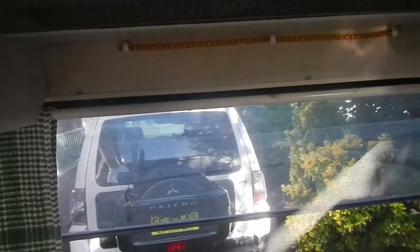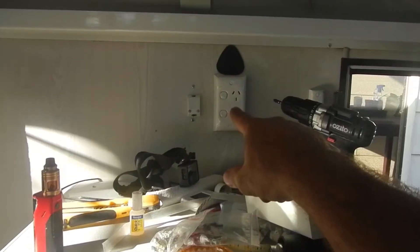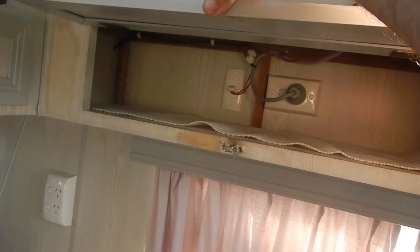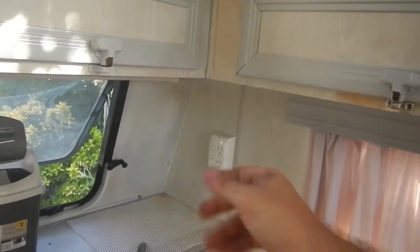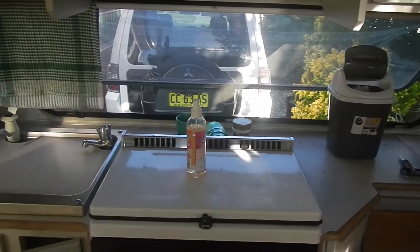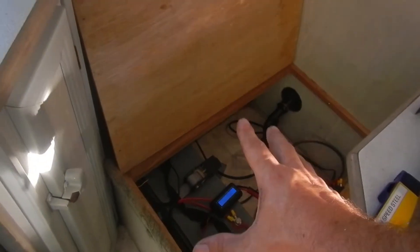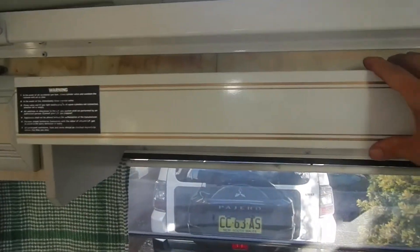I'm in the process of converting everything to 12-volt. I'm going to leave a couple of exceptions — two lights over the bed and our 240-volt sockets, one there, one there, one at the front of the van, and one up here which powers the lights up top. We'll keep those just for lights and hook-ups. The only time I tend to use 240-volt is if I go imaging with my telescopes — it's nice to have 240-volt to power the laptop and all that. But for now, the battery and 12-volt is our focus. So let's get to it and convert our range hood over to 12-volt.